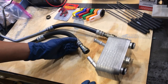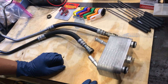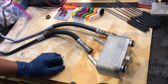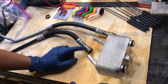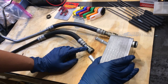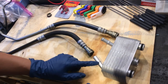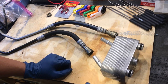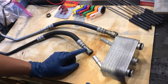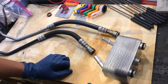Quite frequently on these lines, as the cars get to their age — the car is nearing 20 years old almost — the o-rings in here deteriorate. They don't seal like they should, and when you go to change out the cooler and reattach these lines with the old o-rings they'll leak. It's not necessarily the cooler's fault but the fault of the deteriorated o-rings. We'll use some pick tools to pull those out and I'll show you that.